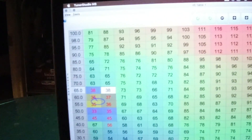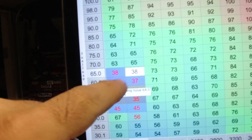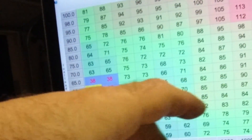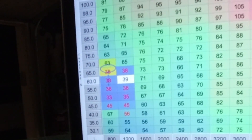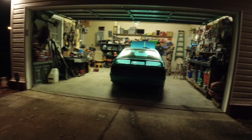The car already changes tones just by changing a few of these cells. Basically what it's doing right now is interpolating in between all these cells. We are actually a little lean right now — we're at about 14 to 15. What I'll do is just come in on idle; you can really play around with this. The car needs to be adjusted a lot better than what it is right now, obviously. I know a lot of you tuners out there are like 'oh my god you don't know what you're doing' — and you're right, I have no clue, but we are learning.